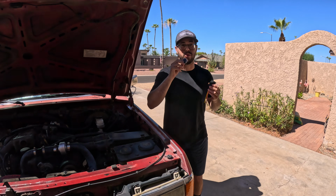On these classic Fords, the old thin wire that runs throughout the cabin creates a ton of resistance, which means the fan isn't running at the amperage that it should be or could be running at. And that brings us here. Ohm's law states that if we want to increase our amperage, we need to either increase our voltage or decrease our resistance. Well, why not do both? That's right, guys. My auto adventures, now with physics. Yes, science! We're going to start with the hard part first, the resistance side.